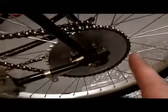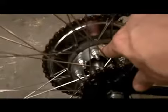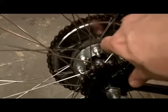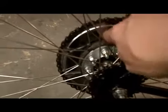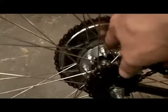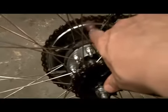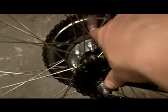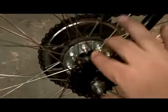The second thing I did was mount the sprocket — that's a little bit of a pain in the neck but it worked out. It comes with these bushings and these metal half-moon clamps that screw right through the sprocket. Depending on your bike, you put the bushings in the back and tighten it up so the rubber bushings push the spokes up against the sprocket, giving a nice tight fit so it can turn the wheel.